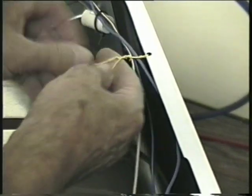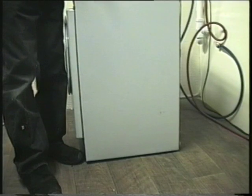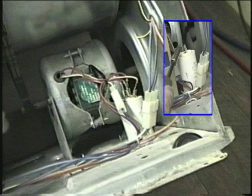If you have not done so already, make sure you undo the wire holding the cables onto the panel. Use an insulated handled screwdriver and short out the terminals on the capacitor before touching it, or you may get an electric shock, because capacitors can hold a charge for a short time after being disconnected from the power supply.